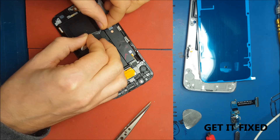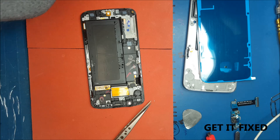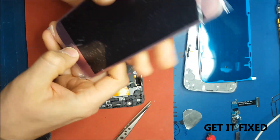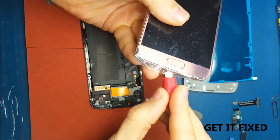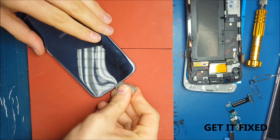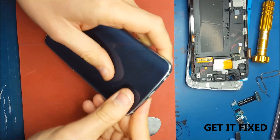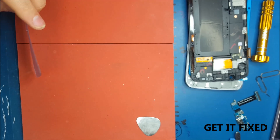I'm going to prepare the new LCD for the repair. As you can see I removed the old tape from under the battery because if you leave it there it will create a problem when you put back the glass back cover. If you leave any thick tape it will push back through the metal bezel into the back glass and in time it will come off and it won't look professional.